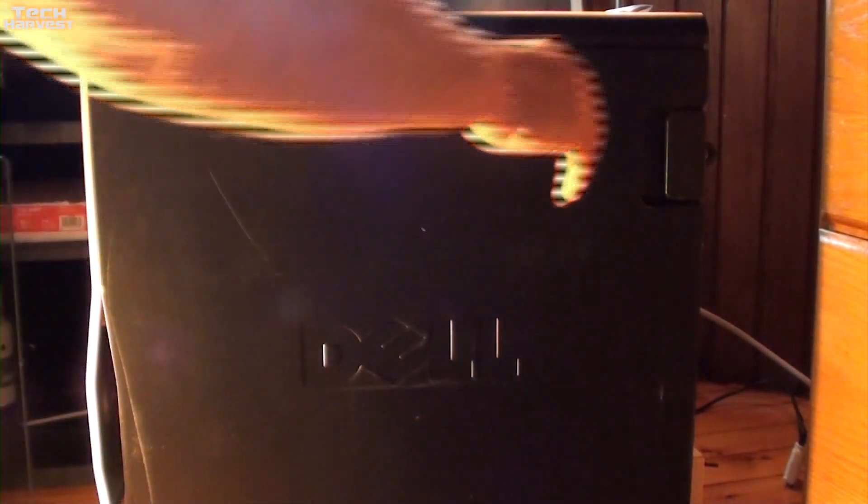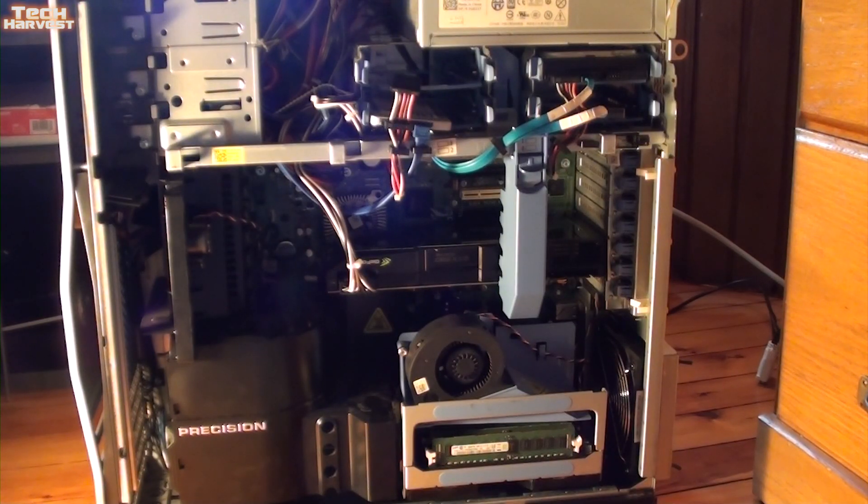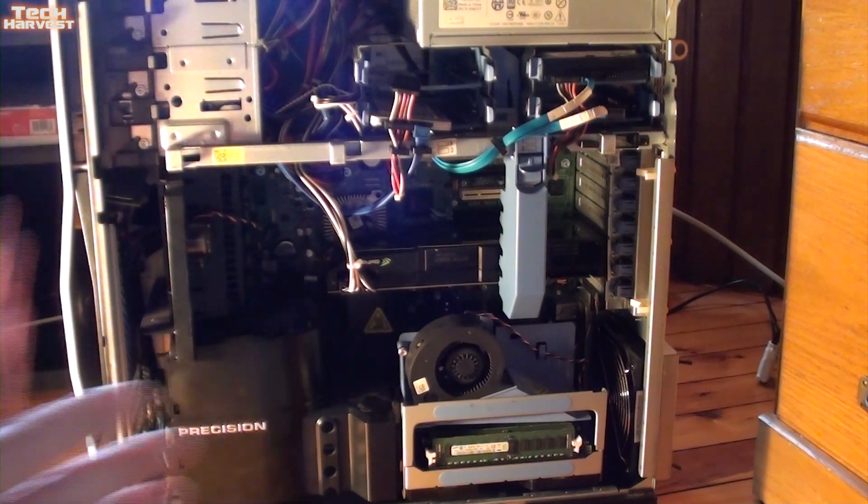On this case it's pretty simple — you just have a latch over here that you pull out, the door comes down like so, and exposes the innards of the machine. For those of you who are new to a process like this, you want to make sure that your computer is totally unplugged from everything — any monitors, any external speakers especially if they're powered, the power cord, and any USB devices, especially externally powered USB devices. Basically this machine should be unplugged from everything before you do something like this.